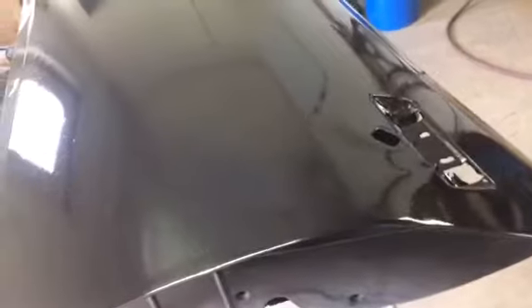Saturday the 9th of September, about 3:30 p.m. We've got the door cleaned up, all of our short-strand fiberglass kind of smoothed down, and we went ahead and shot it with two coats of epoxy. There's a lot of little dirt nibs — just trash mostly. But the door's not too terrible bad. You can look down — this top part, just a few little bumps, and there toward the other end we knew we had that one in the middle. None of this has been body work yet — it's just in epoxy to try to keep that door skin from getting rusty.